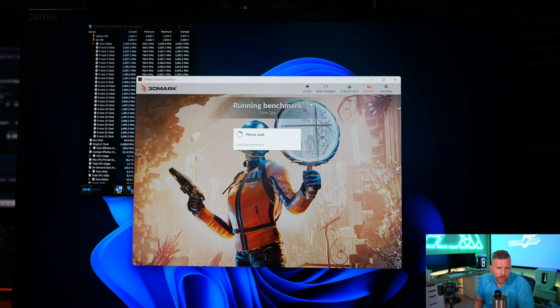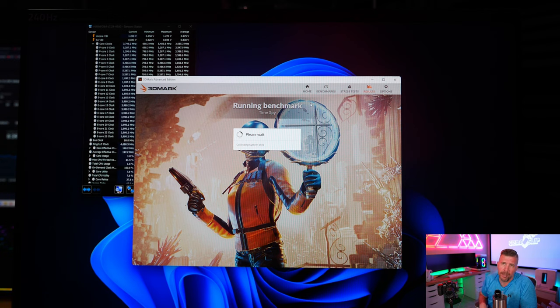Talents Tech asks, can you undervolt and overclock with Intel XTU on the Razer with HX? Yes, but you need to set the right settings for your Windows and in your BIOS, and then you have to enable it in Razer Synapse, and then you can undervolt and overclock. At least undervolt and raise power limits. I'm not sure about overclocking. I don't know if the actual CPU clock ratios are available for changing, but we'll see. I'm going to do that in the live benchmarking live stream.